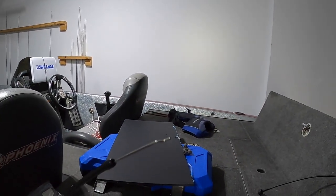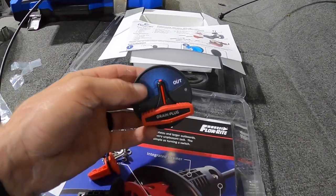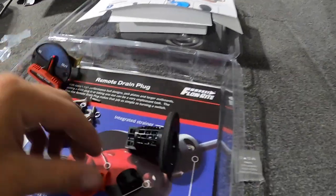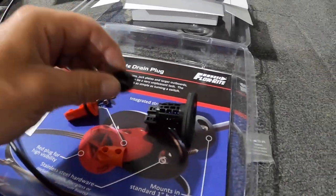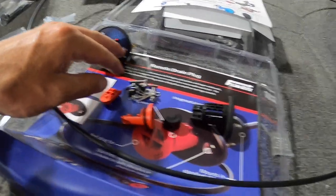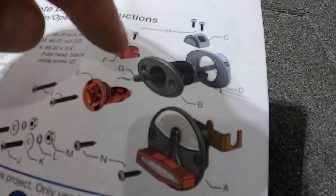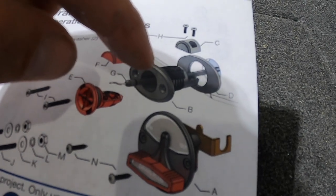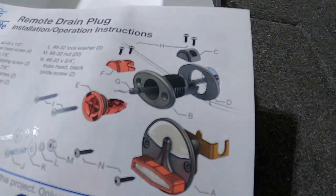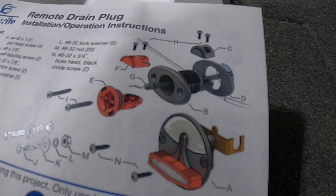We have your cable here. This is the end that's going to actually attach to the remote drain plug, and this is going to be the end that goes to your handle. Then we have the remote drain plug itself — there's a little foam gasket in here, a little backer piece that goes on top, the other half of the remote drain plug which is the actual plug itself, and all the hardware you're going to need. Looking at this little diagram, basically we're going to run our cable through first, slide this piece on, make sure you have that little gasket behind there, and then we'll be able to screw this piece onto our adapter. Then we'll assemble our drain plug and go from there.